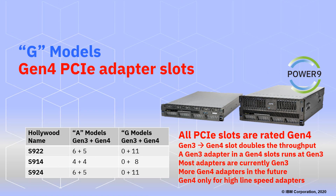There are much bigger changes in the PCIe adapter slots. From having a mixture of Gen 3 and Gen 4 adapter slots, we now have all Gen 4 adapter slots. Why didn't we have them all Gen 4 to start with? To have that number of slots, we need Gen 4 hub switch chips, and they weren't available when the original machines came out. Now they are, we've swapped out the Gen 3 hubs for Gen 4 hubs, and now all our adapter slots are running Gen 4. From Gen 2 to Gen 3, bandwidth into the adapter slot doubled, and from Gen 3 to Gen 4 it doubled again. You can run a Gen 3 adapter in a Gen 4 slot — when the slot powers up, it detects the Gen 3 adapter and slows down to work at Gen 3 speed, so the adapter will work at the maximum speed it can.